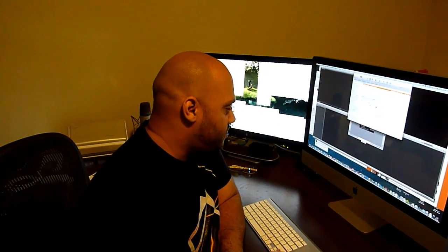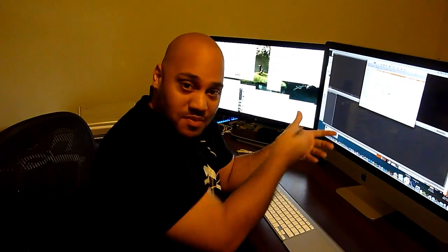Easy, quick, simple — pretty much anyone can do that. All you need is the strength to turn your Mac over to its side, unscrew three screws, pull a couple of tabs out, insert the RAM, and re-screw it. That's all it takes. Five minutes will save you way more money than five minutes spent doing almost anything else. I'll give you a link to where you can buy this RAM — MacSales.com is what we like. It's very inexpensive, it's great RAM, it works in the iMac, and you save cash. That's especially a big deal if you get the high-end iMac.